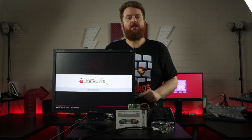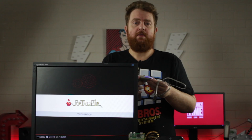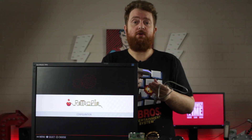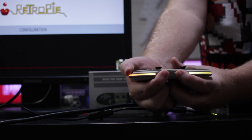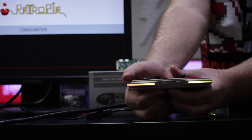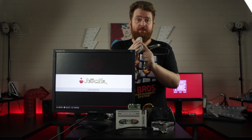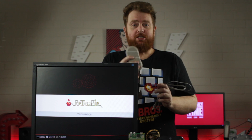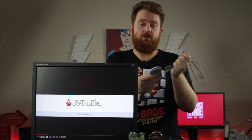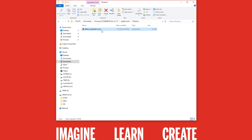Click on the link to download it. One of the things with the firmware on the 8BitDo controller is you need to use the provided cable. You also need to put the controller into firmware mode. To do that, hold down the start button and the wireless sync button for about 5 to 10 seconds. It will then start flashing yellow. Make sure you don't have the USB plugged in beforehand, because if you do it won't register that it needs to go into firmware mode. Once it's flashing yellow, plug the cable into the controller and then into your PC, and start up the software. After extracting the firmware to its own folder, open up the executable file.